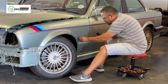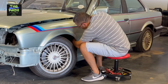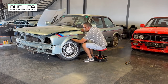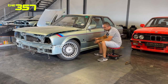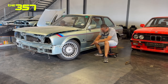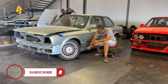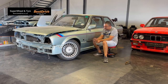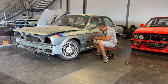Is there anything connected on this car? I wonder why, when we've done a checklist on this vehicle, there are so many wiring issues. I don't even see the harness here for the indicator. We know that the electrics on this car are going to be a big problem. With your MTEC kit, it's a very simple setup - you normally have clips on the side and a very similar clip to your beading clips at the top. At the bottom you've got a clipping system that clips onto your sill - normally a size 10 nut. Pull the clip out and we can pop the sill off. There shouldn't be anything holding in the front.